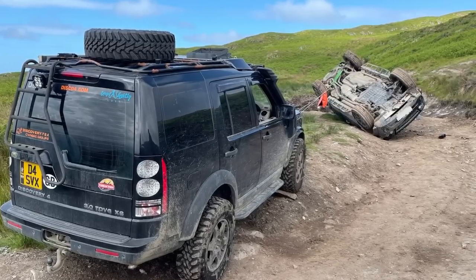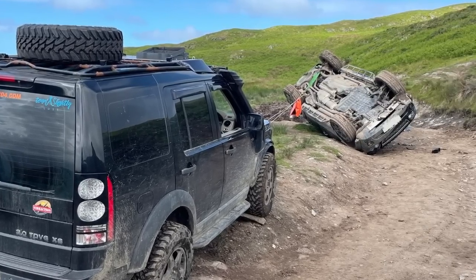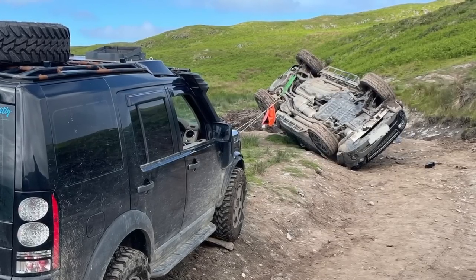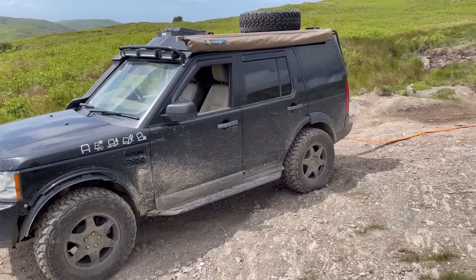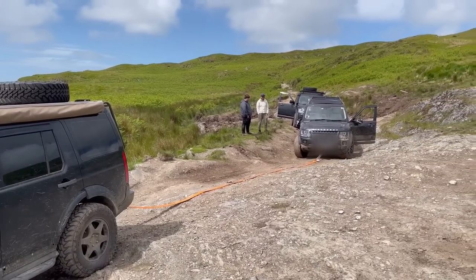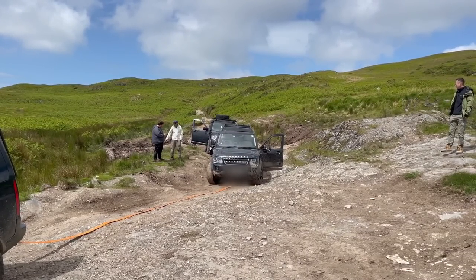This was how we had the disco set up for winching — we used a couple of wheel chocks in front and behind the wheels, and where we were placed was against the natural bank, so it was pretty solid. The next job was to get the disco down off the track. To do that we had to pull the manual neutral release, which is underneath the cup holders on the 8-speed discos. Once in neutral, we attached my vehicle to the front and Ben to the rear to act as a brake, then began the long process of dragging it down off the hill.